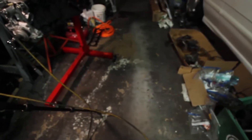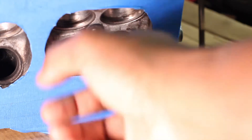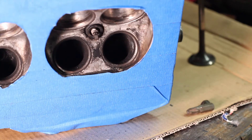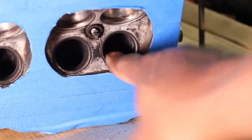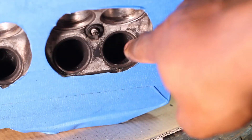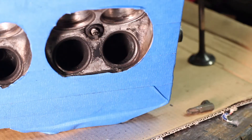I'm not really gonna be revving much higher, but I figure it'll be a good idea for forced induction. So if you look at the exhaust port and the exhaust valve seat, you can see where it's not exactly very shiny anymore. It's kind of jagged — that would probably seal, but while it's apart you might as well take some time and clean that up.